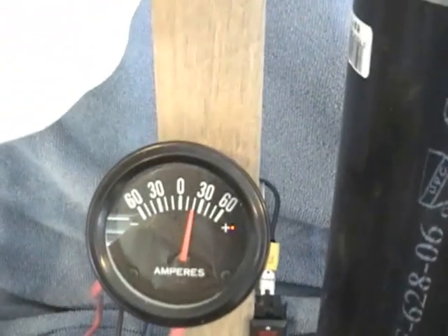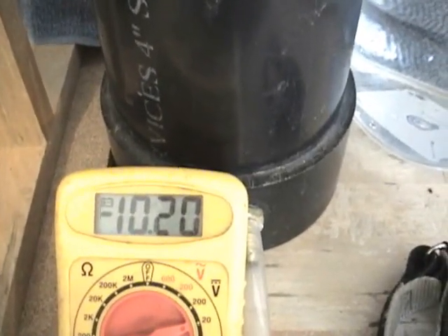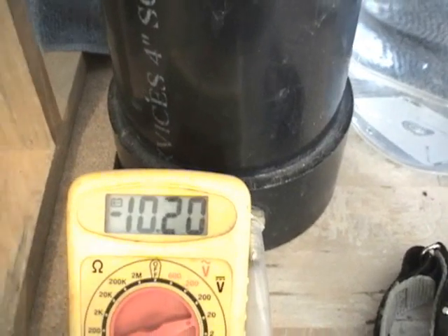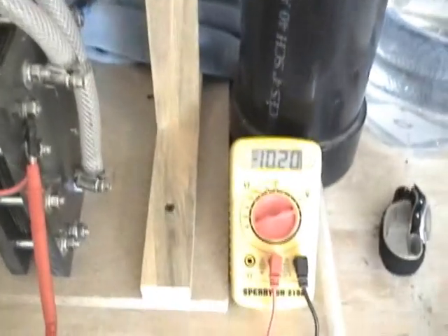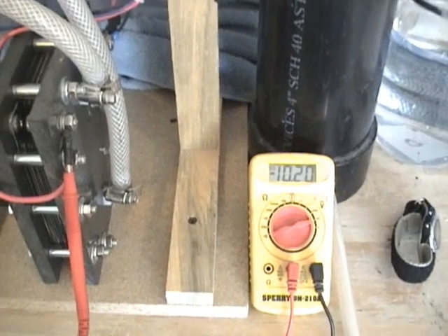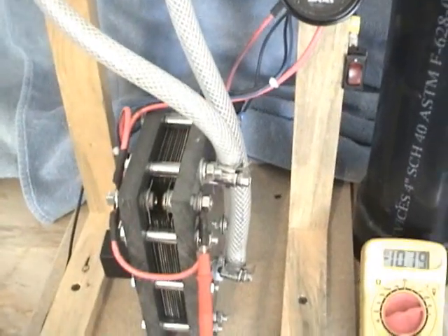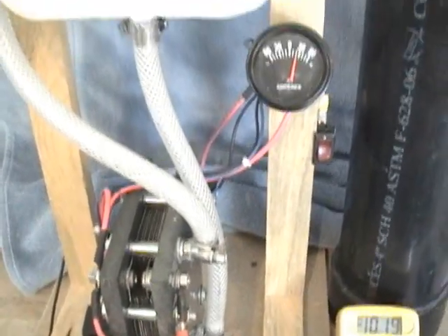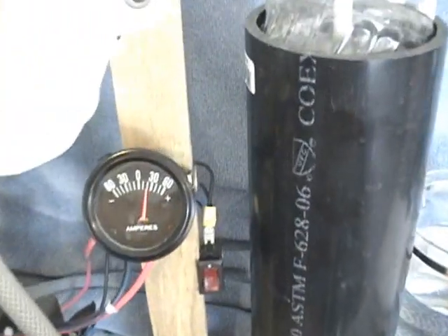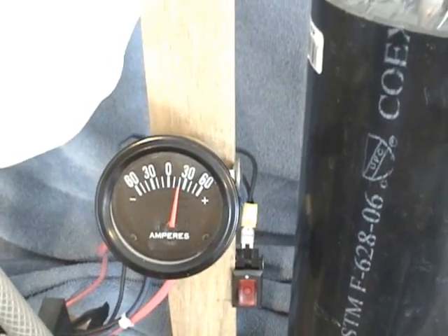And like I said, we are at about 20 amps, looks like about 10.2 volts. So in your car, this unit would actually be running about 13.4 to 13.7 volts, which would give you a little bit more production. We're looking at about 1.4, maybe 1.5 liters per minute in the car, and your amps will probably be around 25 to 27 amps inside of a car.